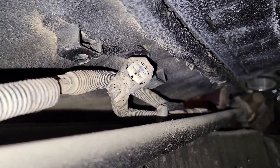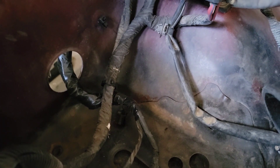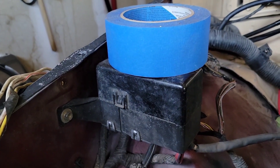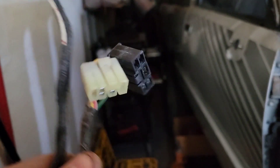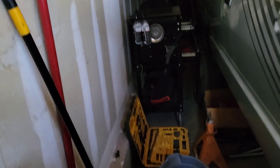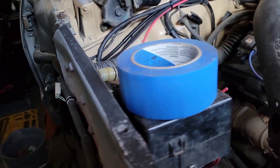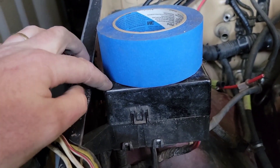Definitely hit them up — they're a great company, I haven't had any issues with them. They know what they're doing. Instead of splicing all those wires in that I showed you, turns out we just opened the fuse panel up and unplugged the wires. These two plugs came out and that was all this wiring mess on both sides. All that wiring I was about to splice into — I could just take my body harness and plug the original back in, because I unplugged it from the old fuse box. No big deal.